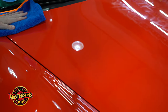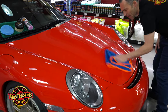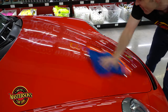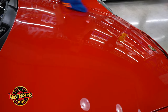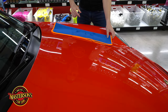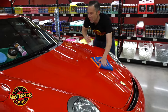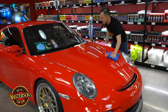This is why I love wax — wax just gives a shine and a look that ceramic coating just doesn't give, man. And this is a real old school detailing method. I'm always really impressed. When you're waxing a car, you're building up friction with the towel, so I'm going to flip it to the short nap side for the last buff. This friction is going to create static cling and dust can be brought to the car, but the detail spray has anti-static properties and it allows it to resist any type of dust and static cling that's going to happen.